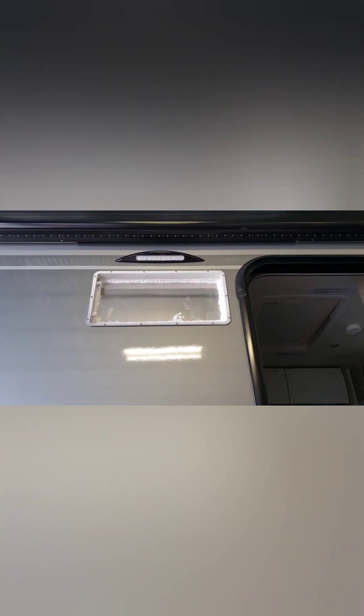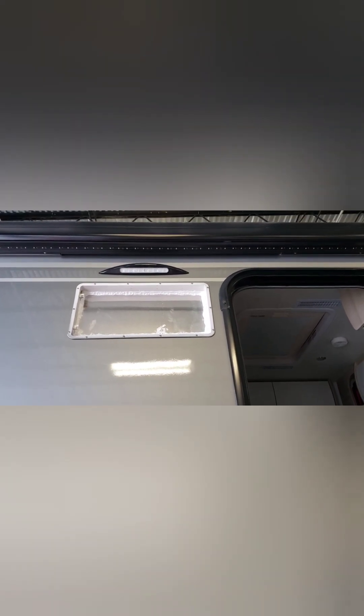I got this caulk done. I just need to do the other one and I'm done. Second opening caulked. We're just waiting for that to dry, and then I'm going to put a piece of Reflectix in both vents, just for another barrier of insulation, and then put the grill cover back on.